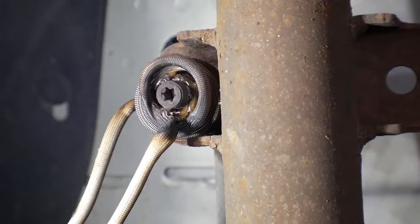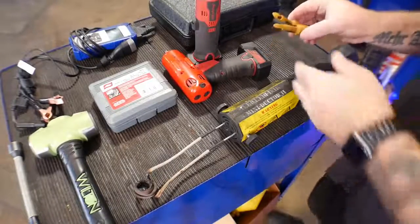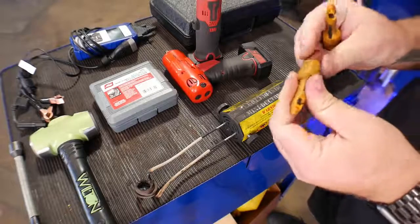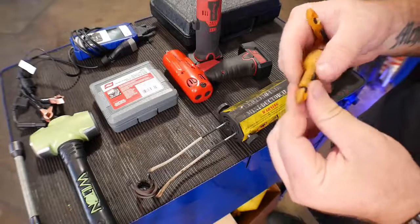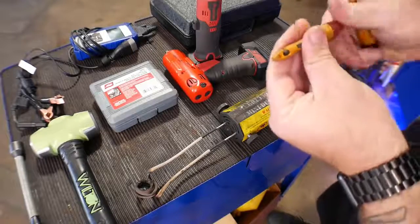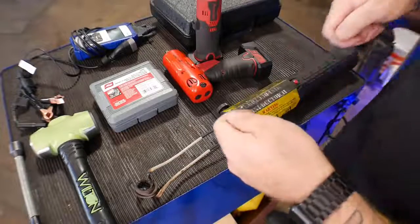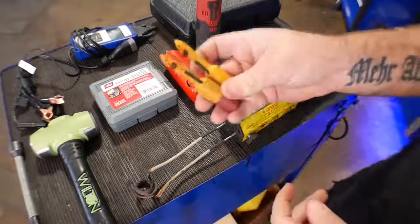Now we're even smoking — it's a great tool. Next up are these wire piercing tools. They come with a Fluke multimeter or a Fluke multi-pack, and it's just another great addition to a Fluke kit. These little black tabs you're able to pull back, insert a wire in there, and tighten the tab down. There's a little pin right in the middle that pierces the wire, so you're not having to shove your test light into wires and jab yourself in the hand. That tool saves you time.